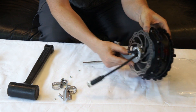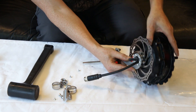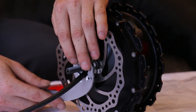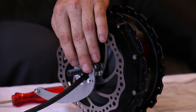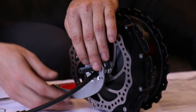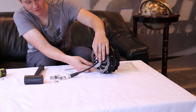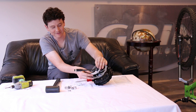If you have a motor with a dropout that angles backwards, orient the arm accordingly. If you have a vertical dropout, it would come out more or less straight down, but the optimal slot will depend a little on the frame geometry and where your bottom chainstay fits. If you're not certain, install the motor on the bike first, rotate the arm to find the closest alignment point, and then seat it down on that one.